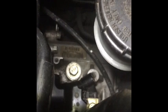The dipstick for it is down here. You probably can't see it. It's yellow, okay? But you don't fill it through there. You fill it through a bolt down there marked ATF that you undo. Let me get my light. There's a bolt there, a big one down there. It's marked ATF on it. That's where you fill it from, but you drain it from underneath. So a little bit like a manual transmission.